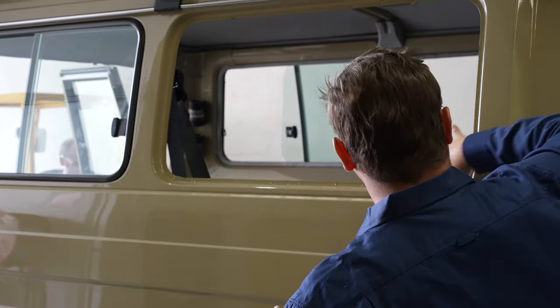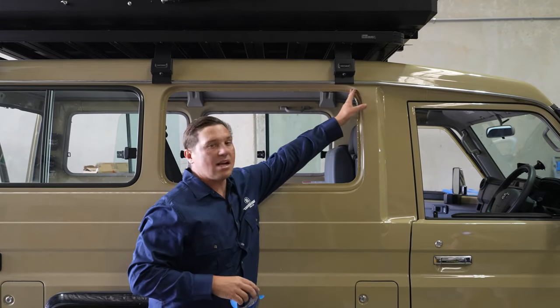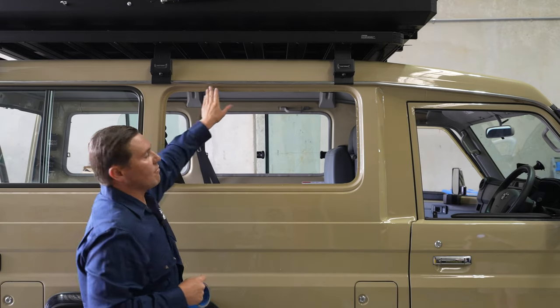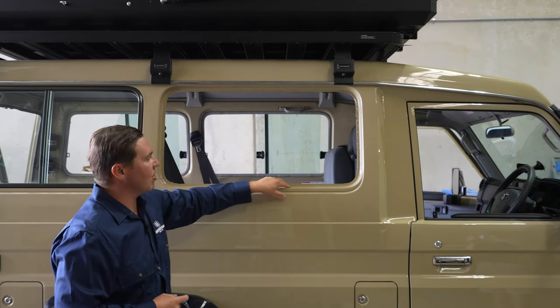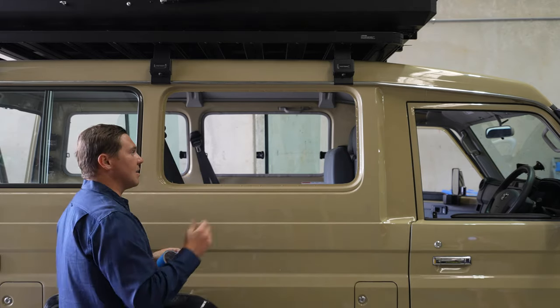We're going to prep this area to put the gullwing in. Get masking tape and mask up the whole frame of the window. From there we can place the gullwing in, mark some holes, and get the drill out. Masking tape is a must — it stops you scratching any of the body and plays a pivotal role in getting everything looking mint. Up the top, you've got some bolts and the window being a nice snug fit, so we put about five or so layers up here which basically aligns the window correctly at the top and bottom. Then we just need to space it at left and right when marking the holes.